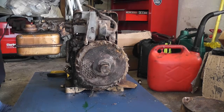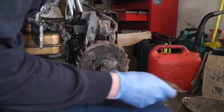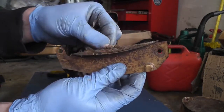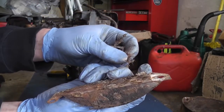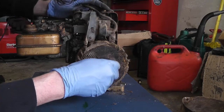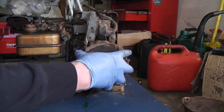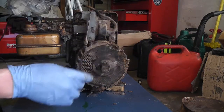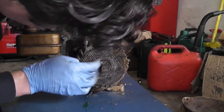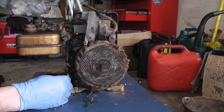God only knows what this engine was used for. I was always intending to take it apart to clean and service it, but the fact that it's turning over... it looks like feathers. I don't think it is feathers but it certainly looks like it. You just don't know what this engine was actually used for. So we need to take off that flywheel because the points are in behind it, and we need to clean up the points. This is kind of sticky stuff whatever it is — it's gross. The engine was getting no cooling with all of this stuff covering it.